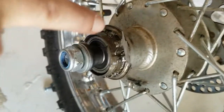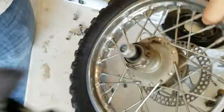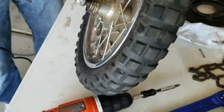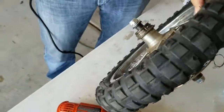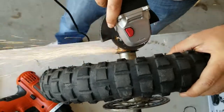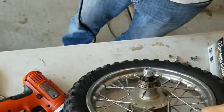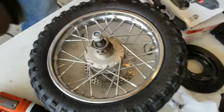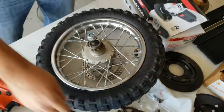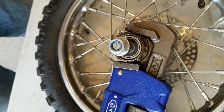Okay, I'm just cutting the freewheel — not cutting anything else. You can see I have a flat spot there, somewhere the wrench can grab. I'll do the exact same thing on the other side. That creates two flat spots so we can get a wrench on there and really torque on it.